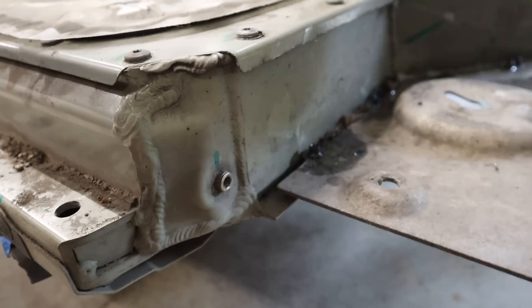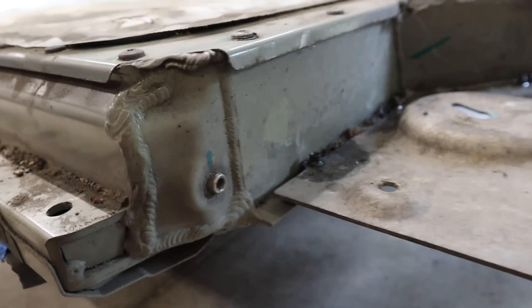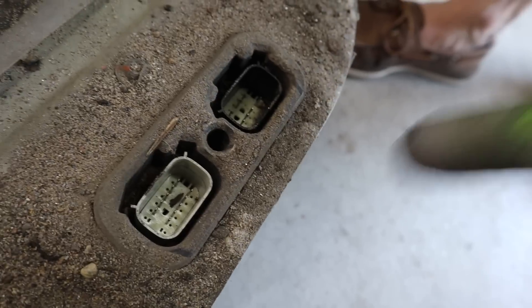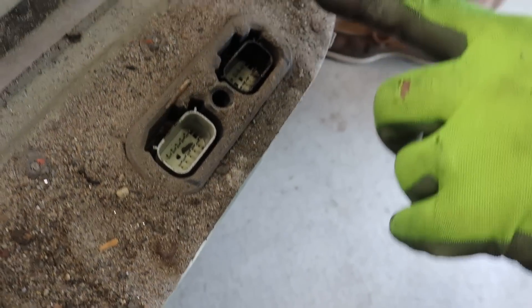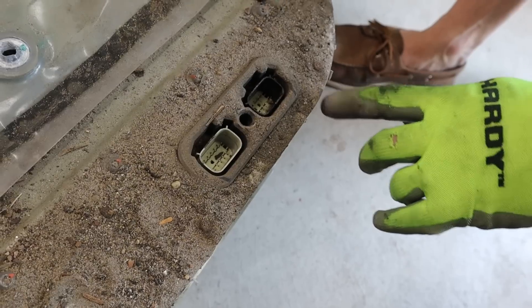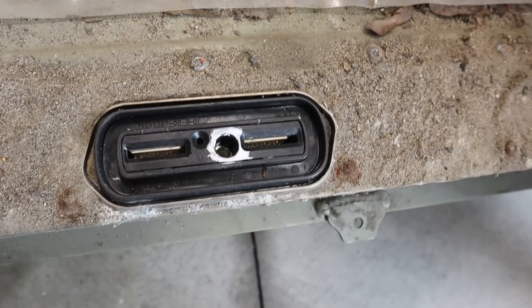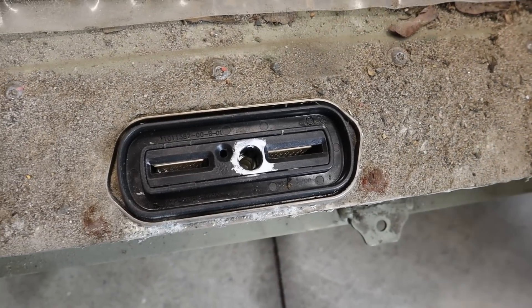At the back of the pack, this was one of those aluminum plates that was supposed to be removed before taking the battery pack out. Unfortunately one of those screws was corroded and stopping that. Over here is a little air fill port — you can pull that out and then pressurize the battery by putting a little pipe nipple in there. At the back of the battery pack you can see how dirty it is, but these rubber seals are around our ports — those are the low voltage ones for the safety interlock, data, BMS, and all that. Over here are the high voltage ports; there's also a ground and an alignment pin. I shop-vac'd this all off and put tape over these ports.